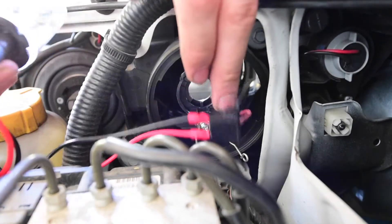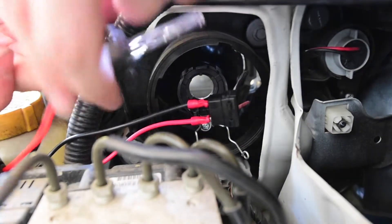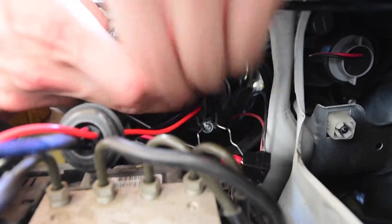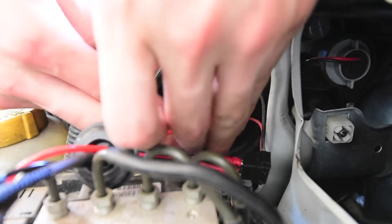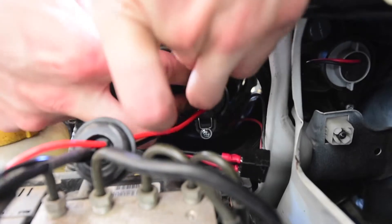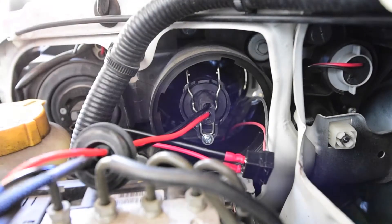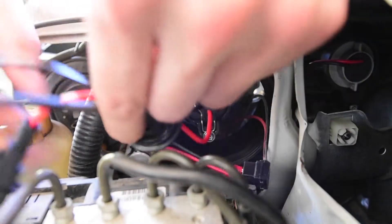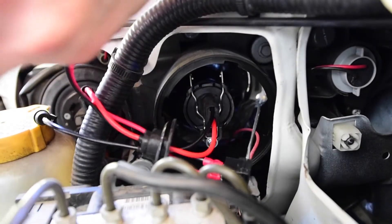When that's done, we're going to install the HID globe. Again, make sure not to touch the globe with your fingers — pull it out of its casing. Depending on the globe type it'll sit in here a little bit differently, but in our case we're going straight down with the tab sitting at the bottom. The tab will sit in like so, and then we simply pull up the two metal tabs and slot them back in place — one on the right side and one on the left. Then pull out any excess slack in the looms so the HID sits nice, without any excess cable.